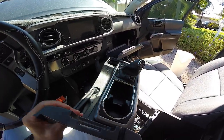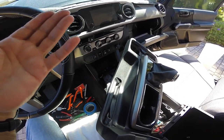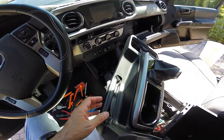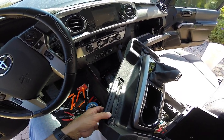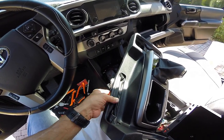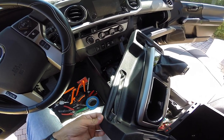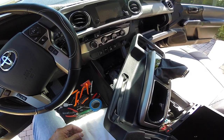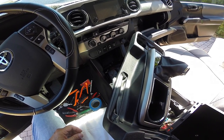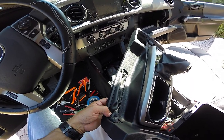A little tip: when you're going to put this dust cover back on, you have to invert it back up, otherwise you're not going to get it in when you put the console in. This way you can finagle the wire into the groove that it sits in. Take my word of advice — otherwise you're going to end up mucking around with that for a good while. It's really easier to do it this way.